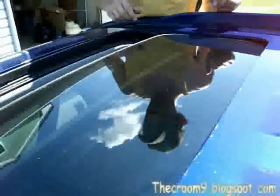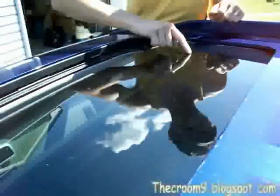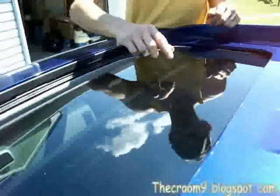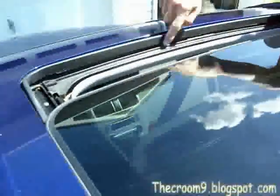And then when you're all finished blowing the tubes out from the back and down through the front, you see a lot of stuff is collected on your sunshade underneath the sunroof. You want to try to bring the sunroof forward and lift it up so you can fit a vacuum in there and clean all that back out, so that way when the wind blows it doesn't shove it back down where you just cleaned it out of. The same goes for in here. You want to vacuum that out pretty good.